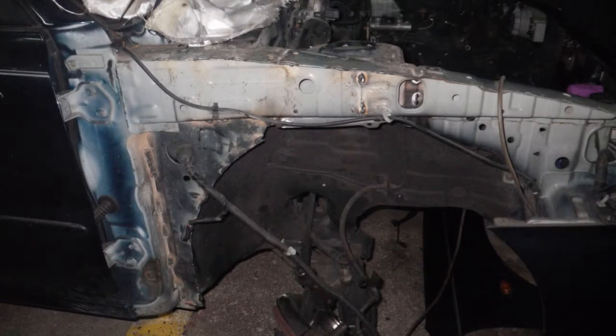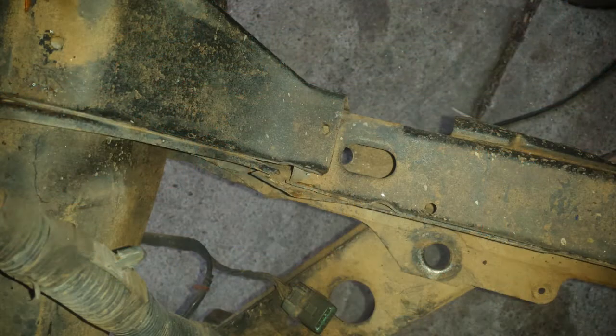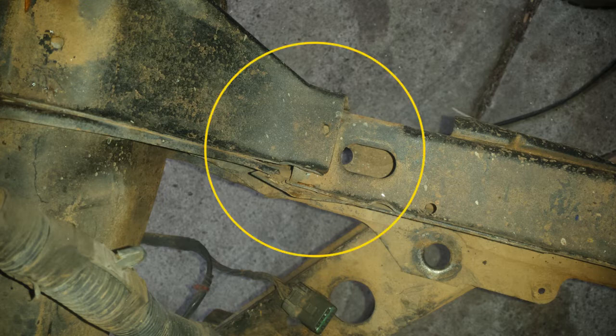Right, let's start taking a look at the car. Let's get under the skin and start looking at structural stuff. I don't mean removing panels, but we do need to look in structural places. Have a look at places where the suspension mounts to the car, underneath, inside the engine bay, and throughout the rear end. You're looking for rust, crumpled or buckled sections, and or split seams, like these ones in the photos. This is a surefire way to tell if the car has been in an accident or had a rough life.